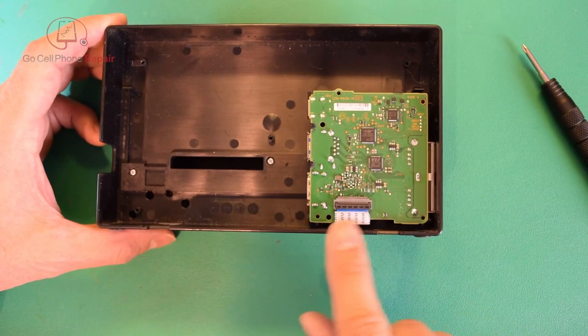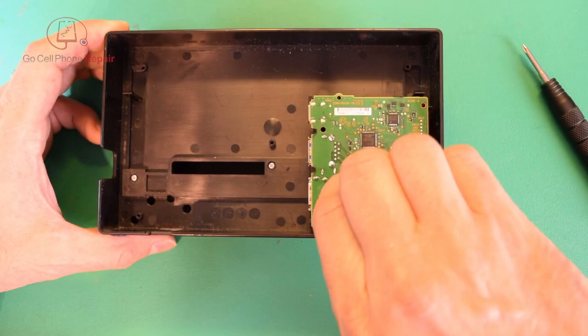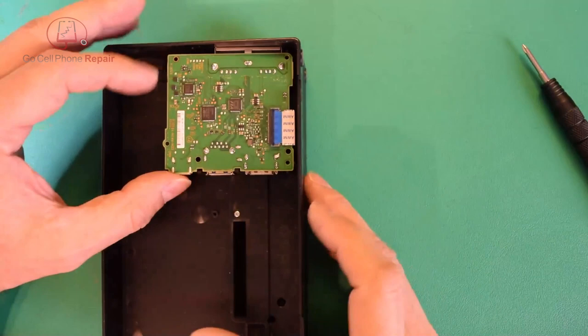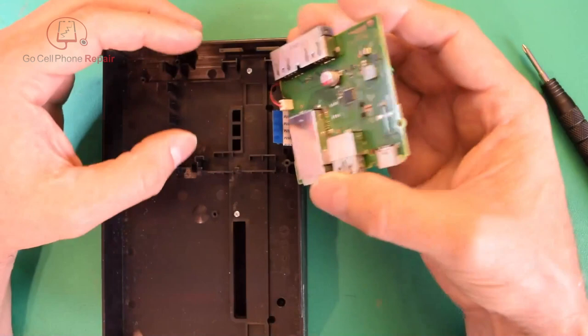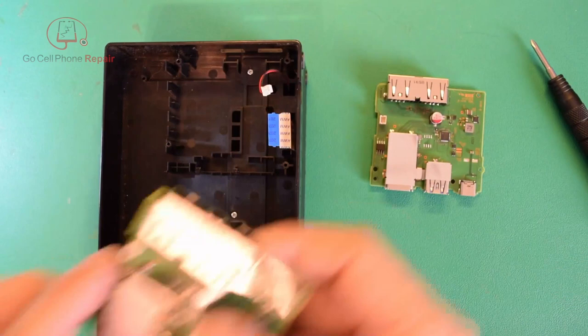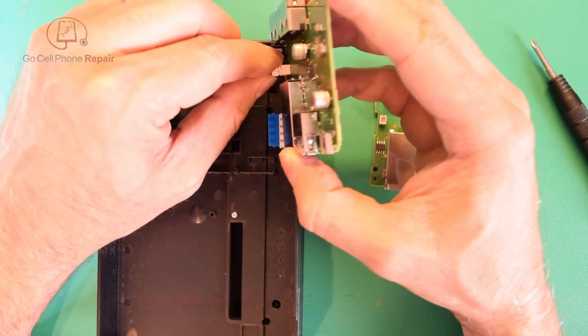There's a ribbon cable here and another cable underneath. What you're going to do is flip this tab up like so, then turn it around — there are two retaining clips here. If you pull these back a bit it makes it a little easier to lift this up. Once you've cleared those two clips, fold it over in this direction and this cable will eventually fall out. More importantly, disconnect this one first — just grab a hold of it, give it a very slight wiggle, and that will pop out just like so.